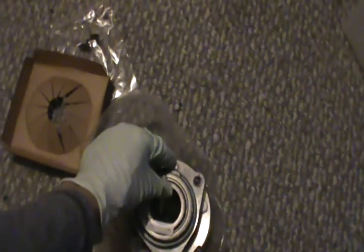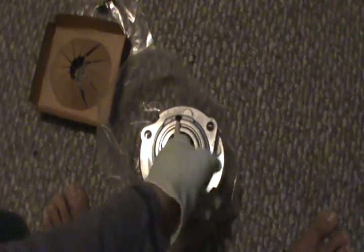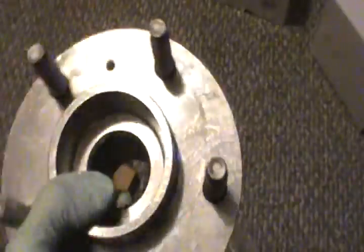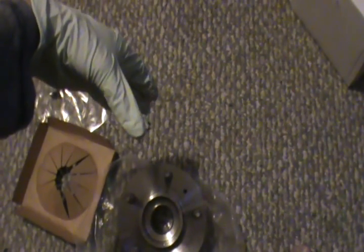We'll be changing this next weekend. The axle goes here, and the engine spins the axle. That cable will be outside plugged in, and as this spins, this thing will spin. There are teeth inside — that's where the axle hooks in. As the engine moves, this thing spins, it spins the disc with it, and it spins the tire. Your caliper sits here and the brake pads squeeze on the rotor disc and force it to stop. That's how your brakes work.